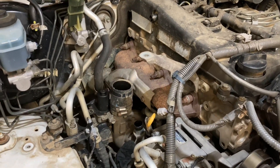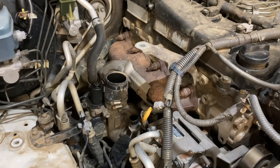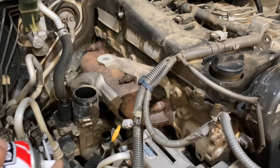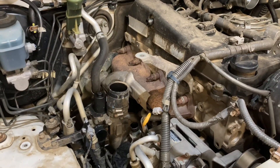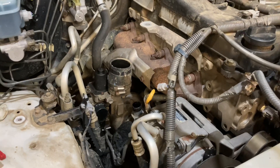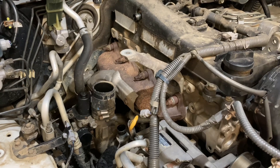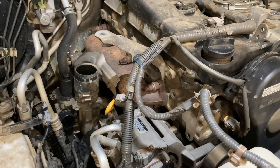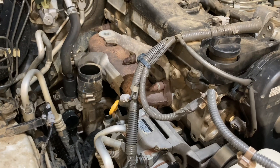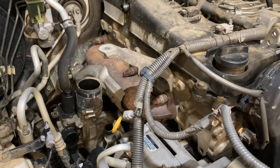So what happened with this one? When did you get the P1251 originally? Was that about a year ago or even longer? Yeah, P1251 a couple of times. Give that a spray - trying to get that plug off down there. Sometimes you get away with lubing that linkage for a while, but in this case sometimes it can just give you an indication of what's to come and it could be a turbo straight away. What happened this time? You got the P1251 - was it straight away or a day or two later? Next day, turbo. So P1251 again, reappeared a year or two later.